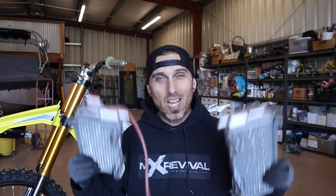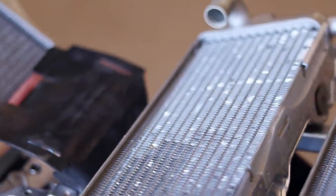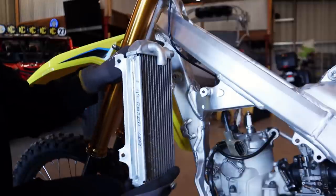That's killer news about the air boot — pumped on that. Time to get into the radiators. These are definitely going to require modification. The RMZ radiators have a few fewer outlets or spigots than the RM250. Because when I bought the RMZ 250 chassis parts I picked up the radiators for that frame, I still have my 2018 RMZ450 radiators as well. I'm going to show some of the different clearances between the 450 particularly on the left side, then put the two-stroke radiators side by side with the four-stroke ones to see how they need to be altered.